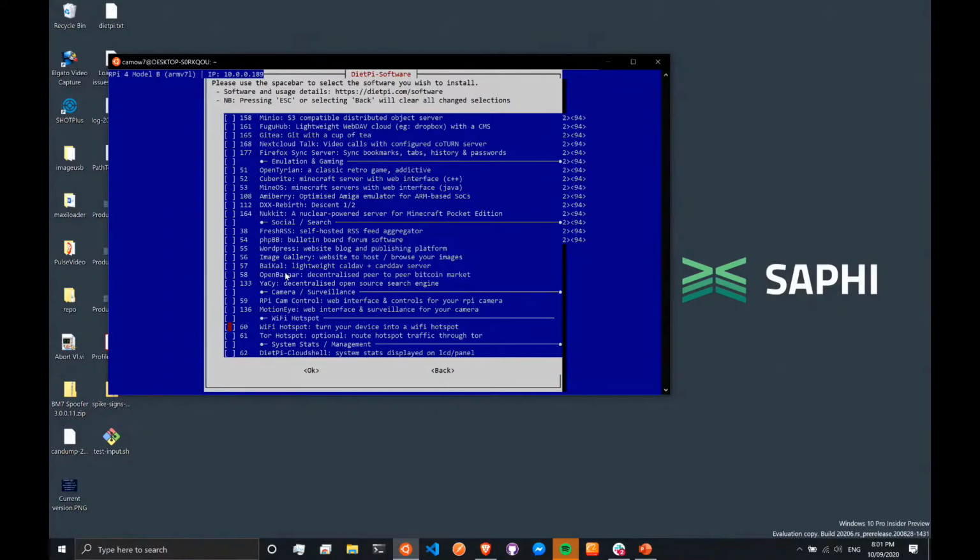Like I said, whether you're out in the field with no internet connection, you just need to get on the Pi and run some code, check some things. Definitely have a go at setting this up once or twice. Really easy, it installs everything, and it creates a screen where you can set the SSID for the access point, the password, and the channel that it's running on. I'll keep 4.